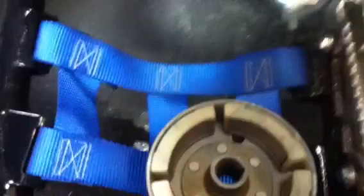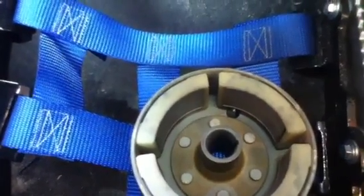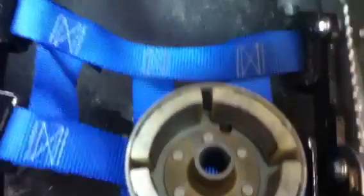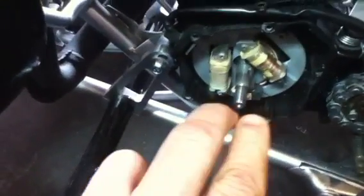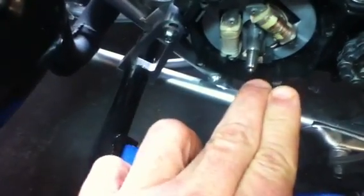Also, while you're grinding, you'll feel at first a lot of friction, and then it'll very quickly dissipate — you'll have a lot less friction — and that means the compound's breaking down, but it's actually doing its job at the same time. Now you're melding these two V-groove surfaces together, and that is actually what holds the flywheel on the crank with the nut. It's like having two fingers tight together versus one of them V-ed apart — there's not as much surface area to grab, so you have to make sure they're melded together, and that's what gives it its grip on the flywheel.